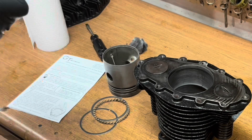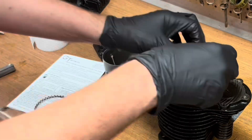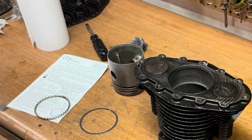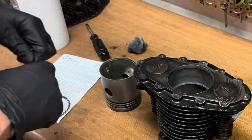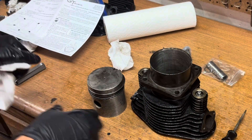Repeat this process for your remaining piston rings. If a gap is too small you'll have to file the edge of the ring to open the gap slightly. If a gap is too large and your cylinder is within spec, you'll have to buy the next larger size ring and file the ends to get the gap to the appropriate size.